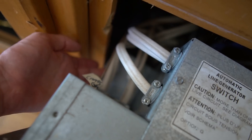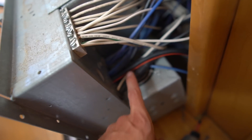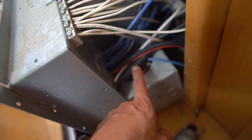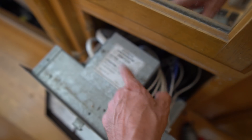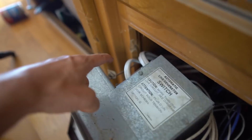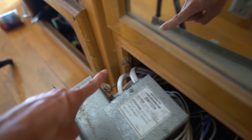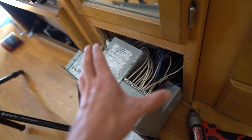The wires down here are the AC wires going out to all the receptacles, and on the back are the ground and positive wires for DC, and the main battery cables going to your house battery. There is not much room behind here to put an automatic transfer switch — we have a duct, other wires, it is pretty crammed. So you may want to find the RV shore power cable and follow it around to find a spot where you can place the ATS and easily connect it to your solar power system.